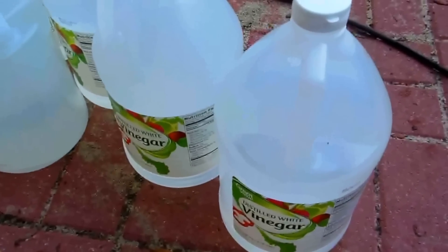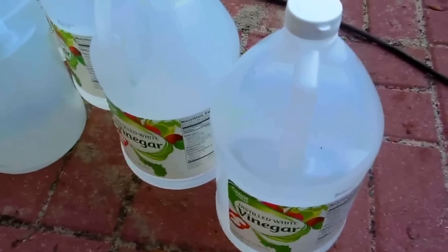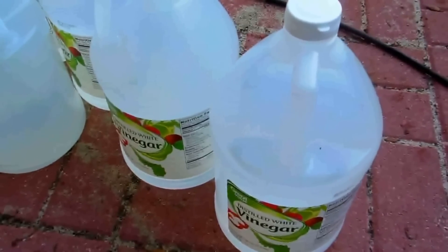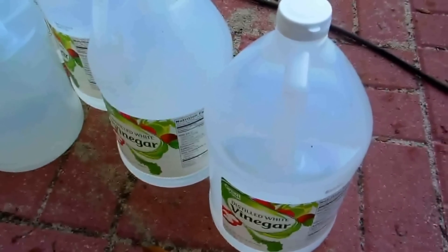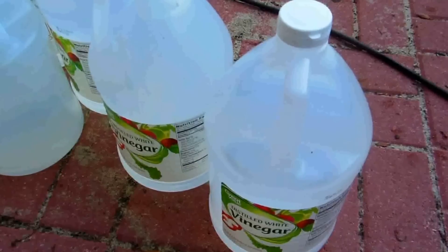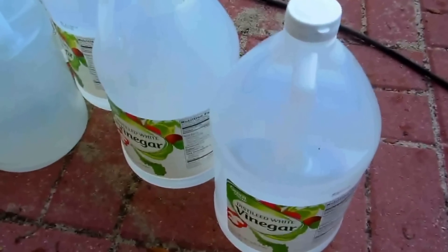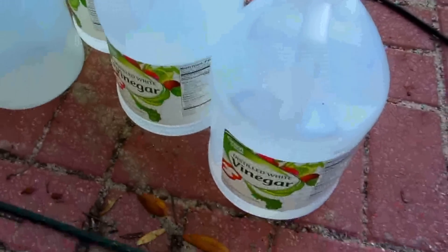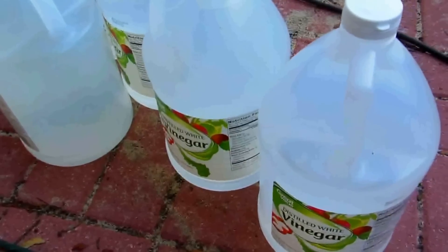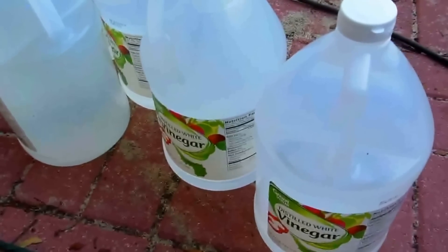But I'm going to get this to perfection before I put it back together. I do it right to the nth degree, and that's when it lasts. I did my motorcycle gas tank in 1990 with a cream product spelled K-R-E-E-M. I did it in 1990, twenty-three years ago, and the stuff is still stuck on there — it never came off, never rusted, no problem. So you do it right and it lasts and lasts. I'm taking my time with this. You gotta let that vinegar sit on there — it's been on there about a week, so that gives you an idea.